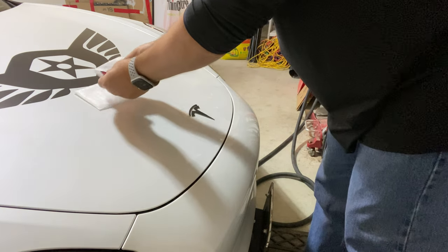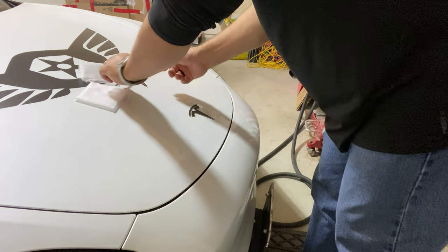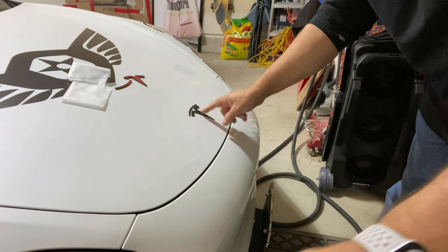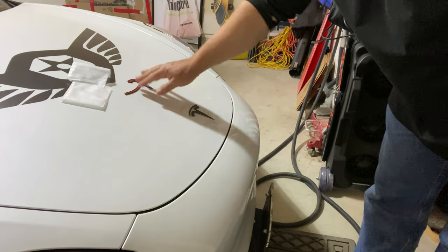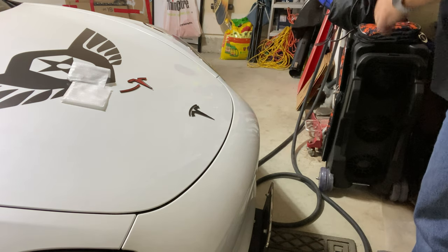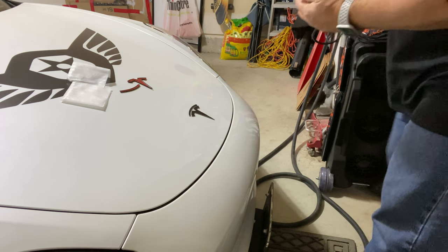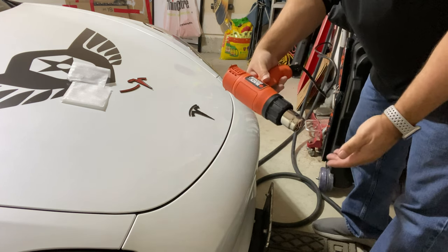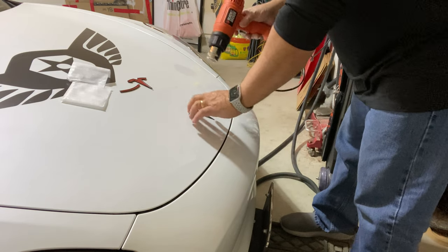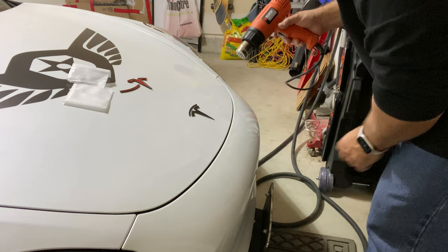And as I showed you, they're ABS plastic with 3M tape, one for each piece. But I already have a wrap, as you call it, black piece here. So I'm going to peel it off. And one thing, as I mentioned, is just get a heat gun, put it on low. So I have a heat gun here, and just ever so gently start putting it on here, just to warm this up a tad.